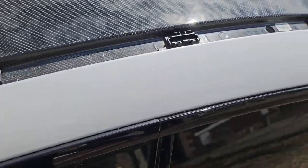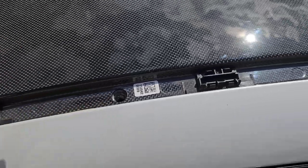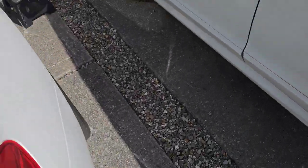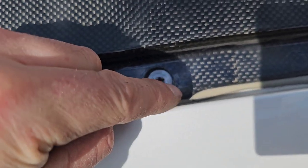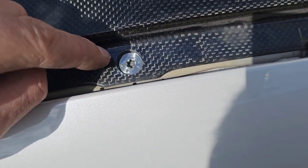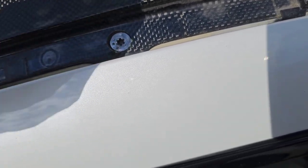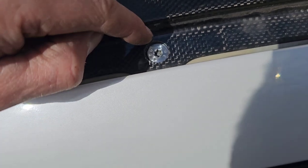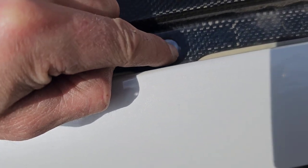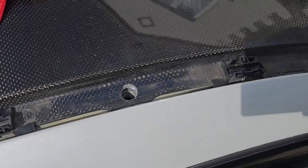So that's all four holes drilled. What I did find was that because these roofs are bonded on, the measurement was slightly different at the other end. So when I measured the same distance, the hole was slightly off - I had to mill the hole slightly towards this end just to get this bolt out. Be very careful: the threaded part of this bolt is just a plate underneath held on with two tabs. If the edge of the bolt gets caught on the carbon as you're unthreading, it'll push those tabs down and the threads will fall out - meaning you'd have to take out your headlining. So be careful. You can crack the bolt off and it's got a little bit of wiggle, so if the edge is just catching underneath the carbon, just push the Torx up a bit and it'll lift that edge out.